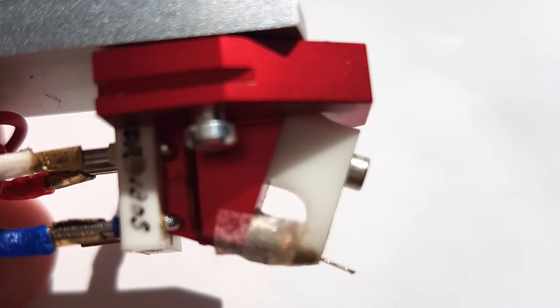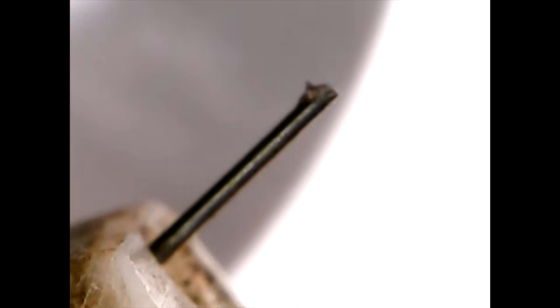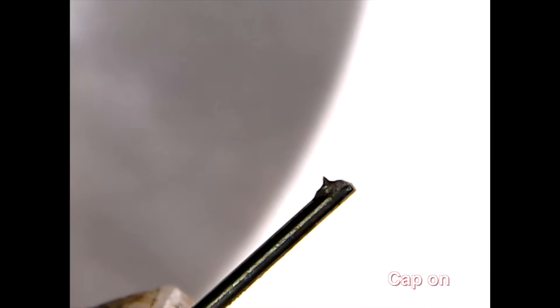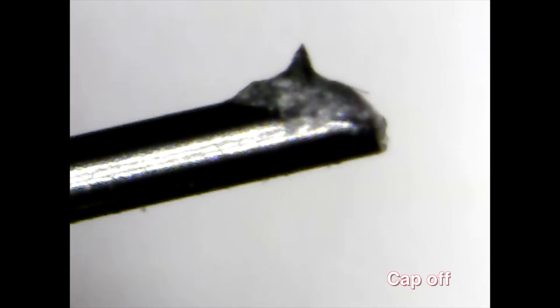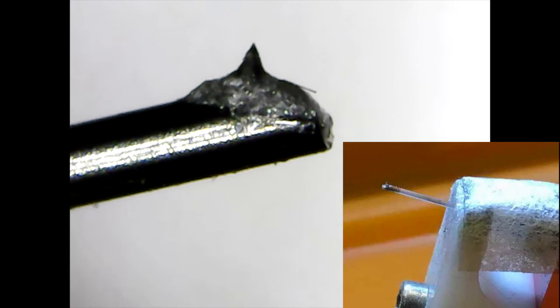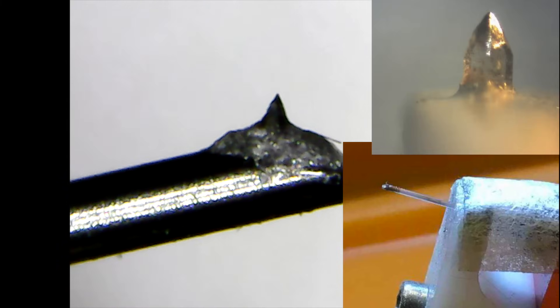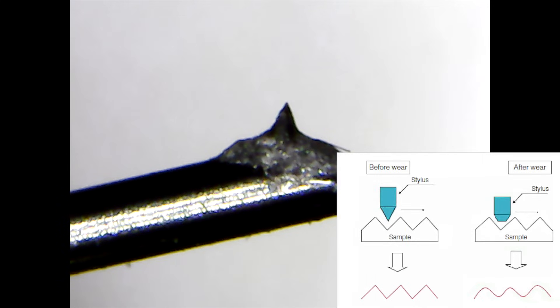This is my Lyra Dorian. In the normal photograph you can practically see that the stylus looks gone. But when we get a little closer, we can see there's a lot of dirt all over the place, and the diamond tip — the stylus — is pretty decent, though very worn out. It doesn't have that much diamond remaining. Getting even closer with the cap off, you can still see the slight cuts of the diamond and how it was molded. Here you can see a picture of a middle-worn Dorian, and here's how a diamond tip should look. We could say this has been almost all worn out, but it's in a decent shape.